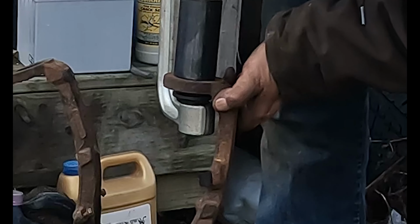Okay, so these brakes are the most pain in the butt ones I've ever worked on. So here's one of the pads, and every pad gets two squeakers. They don't come on them, so you have to assemble that. And then these guides, they have one hook and one spring side. So to slide that on, it's sometimes difficult and it doesn't like to stay.